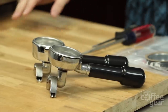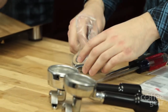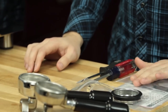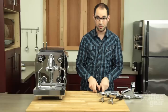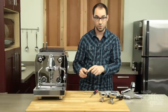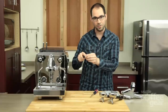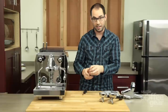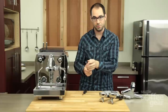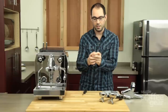The things included in the tune-up kit are your brew head gasket, your shower screen, and in one of the kits you'll find a spacer. You'll also receive a descale solution and descale instructions. Tools you'll need are two flathead screwdrivers — one with a relatively thin tip for prying your screen out of the groove, and another with a wider, thicker tip because the flathead groove for your diffuser is pretty wide.